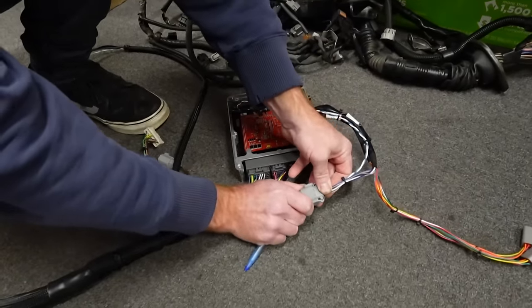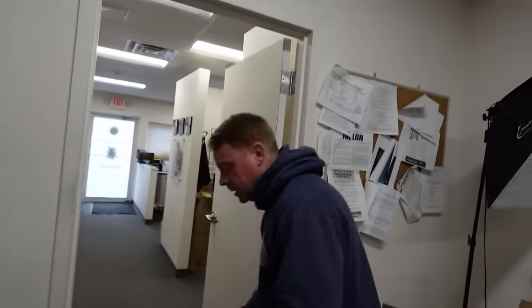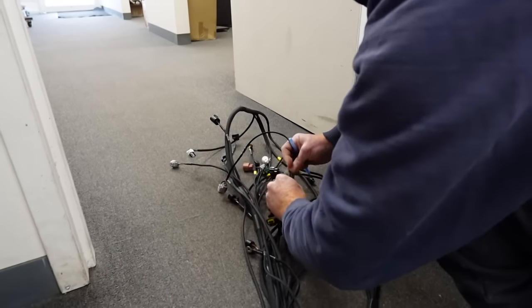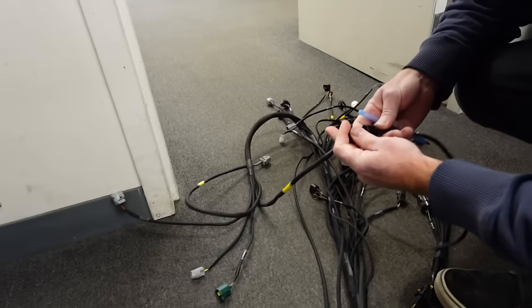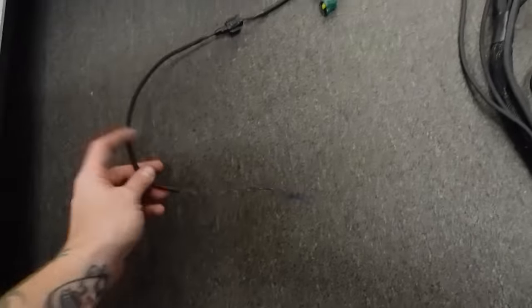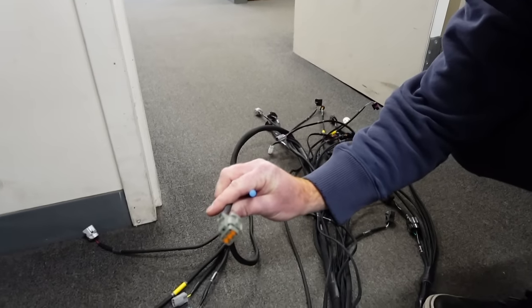And this is the signals we're using. This is your CAN. This is your oil pressure, fuel pressure. Your R35 coils. And then you wanted a factory IAT. So we've got a factory IAT. And then you got a boost controller out here. Yep, and there's a pigtail for that. That's for the MAC valve for the electronic boost controller, because we will be using the Link to adjust boost control. And then I put a fan controller in, so you can use our dual fan kit.